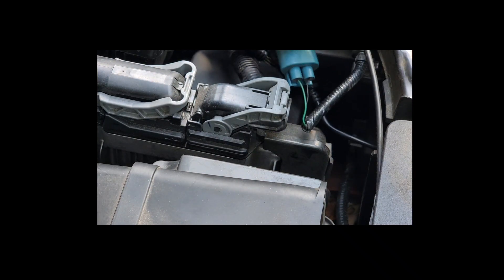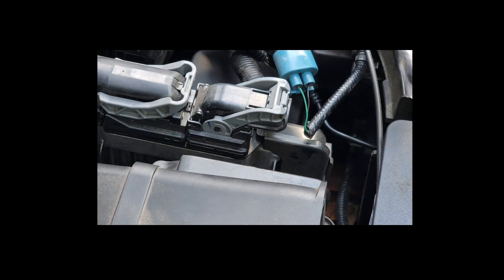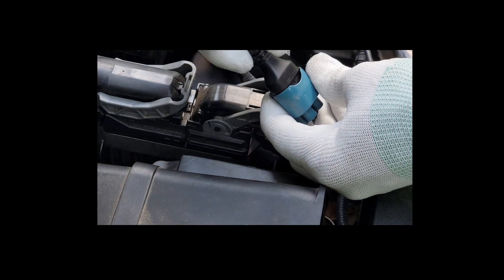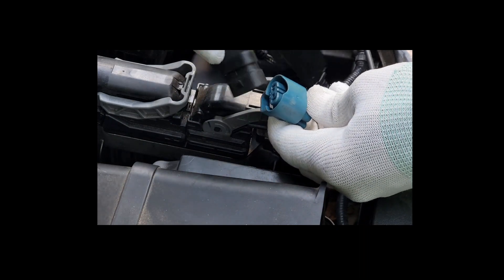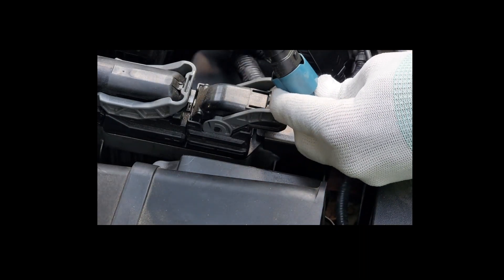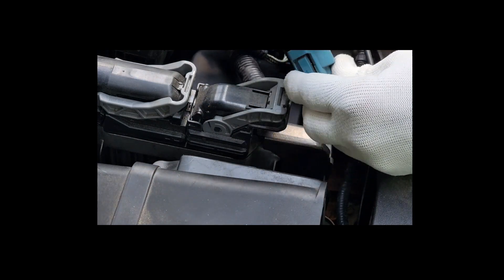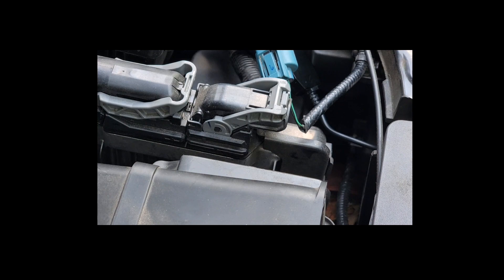I know a lot of these LED lights, these plugs are reversible — so don't panic if you plug them up and turn your headlights on the first time and they don't work. Just basically reverse the plug. It can go either way. So let's fire these things up and give them a try.